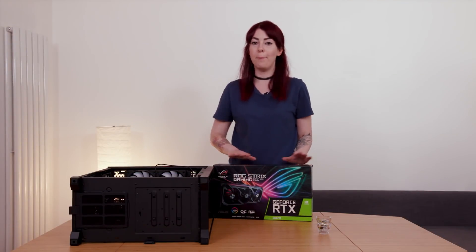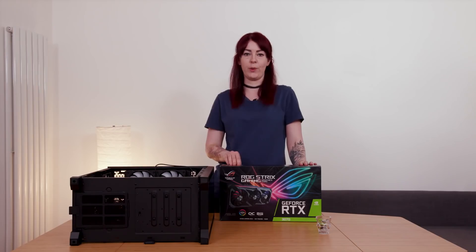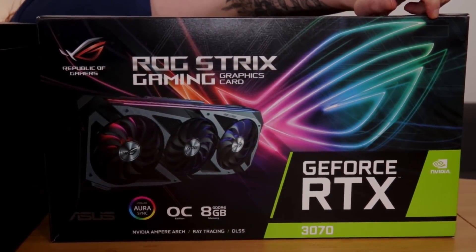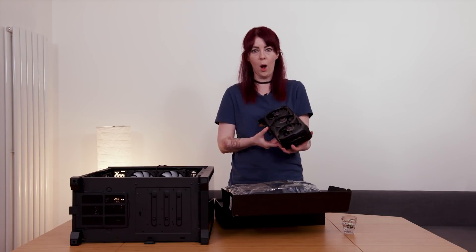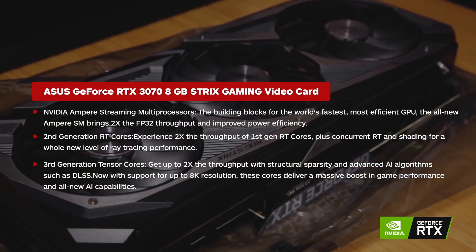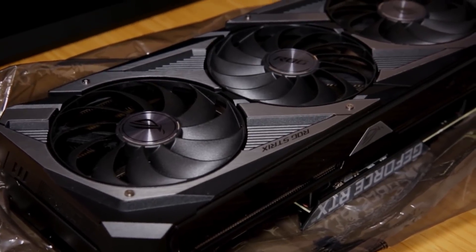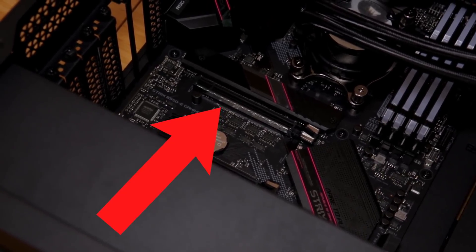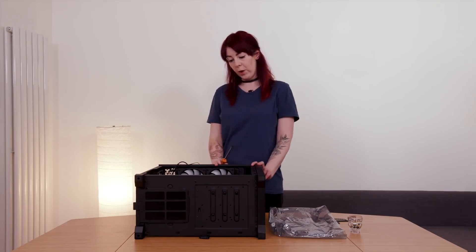Here is my beast of a graphics card — the RTX 3070. This GPU is built with ray tracing in mind, simulating breathtakingly realistic lighting in games. It also supports DLSS AI rendering, so you can run a game at a lower resolution then upscale it with AI to get better image quality at a higher frame rate. Removing the slot bays and putting the graphics card into the top PCIe slot — the motherboard manual says to use the top slot if you only have one GPU. And that's the graphics card in.